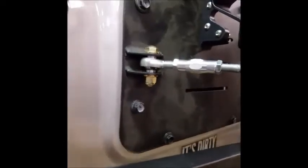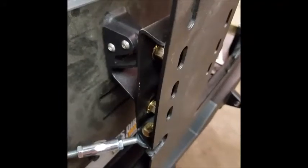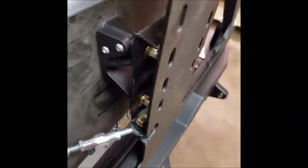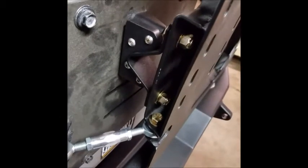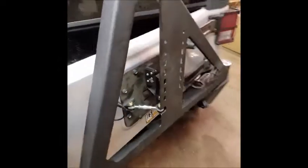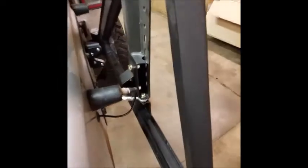And then it's reverse threaded, so get both ends situated and then make it so that it just barely touches before closing. Once everything latches, it makes a nice tight seal on that V-notch. Again, this should have been adjusted up or down by closing the gate and setting that. Now that the heim joint's set, whenever we open the gate, that swings the tire carrier with it until the gate itself stops. Then that limits the carrier.